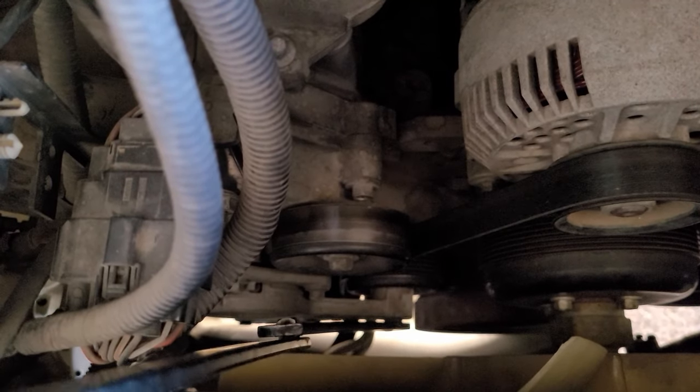Let's remove this tensioner pulley here — it's got three bolts, one right here, here, and here. You guessed it — they're 10mm. This is more of a job for a 3/8 ratchet. We'll wait to reinstall the tensioner until we have our air conditioning compressor reinstalled, because that frees up a little bit of room. Let's talk about flushing your AC system.